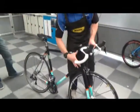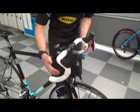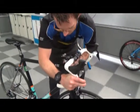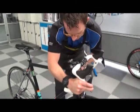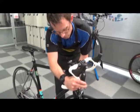You can then check the bearings that live here, and you can do this by putting the front brake on and wobbling the bike back and forth whilst checking for any play that might be present on the top and bottom bearings.